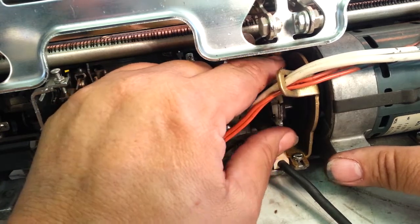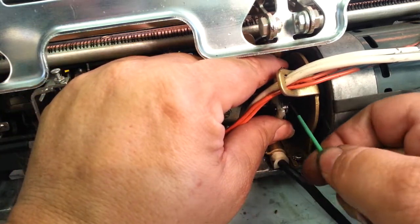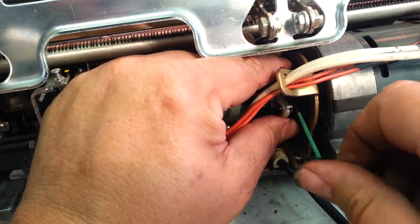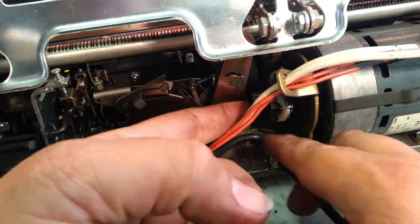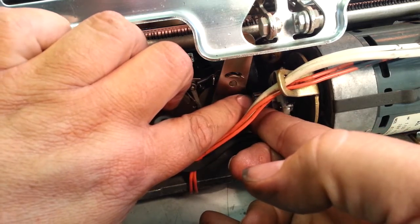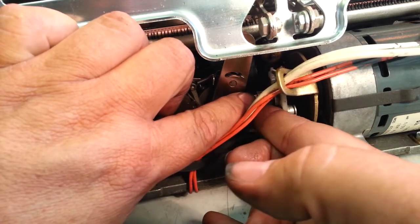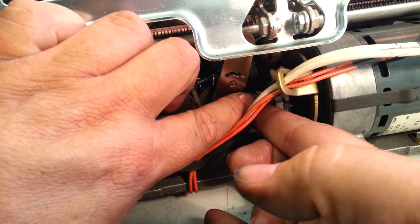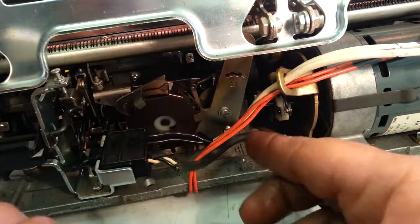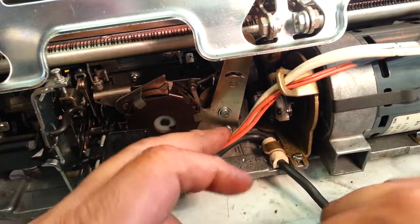The motor pulley is not in far enough, so I'm going to adjust it and move it further in like that. There we go. And then the pulley will slip on the shaft all the way. Just make sure that shim stays in that pulley. You can see it if it's protruding, and it is a little bit, but I'm going to get it back in there with my fingernail. Okay. We can go ahead and put on the belt next. So we can do that.